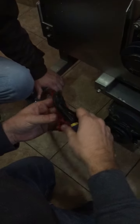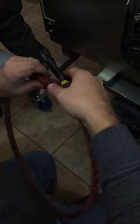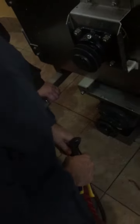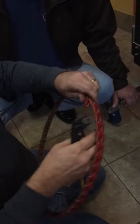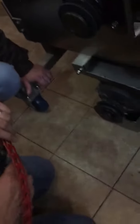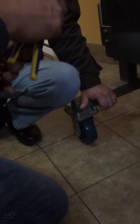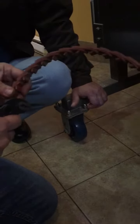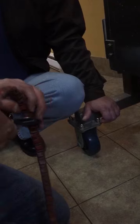So again, this belt has stretched a little bit and it got to a point where it was just hanging and the motor was just bouncing, and probably all the friction, rattling, vibration — a lot of rattling. Could have used a little bit more, and maybe could use another link taken off, but I'm gonna be cautious and just take one off at a time.